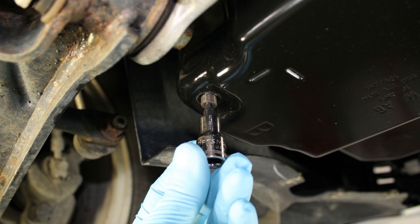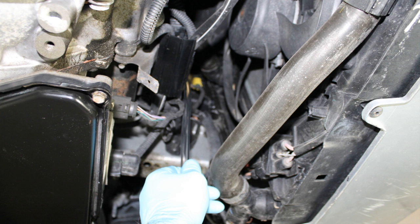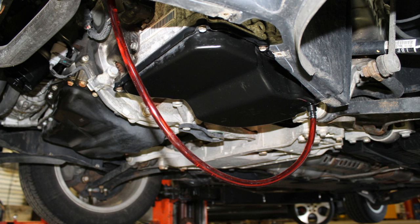Reinstall the transmission fluid level insert using a 5 millimeter Allen into the drain plug port. Leave the insert snug and do not over-tighten, as this is made of plastic. Hand-tighten the fill adapter onto the transmission pan. Once the fill adapter is installed, slide the fill hose on as pictured. Slide the loose end of the fill hose up in front of the transmission and connect it to the fluid bottles as described in the supplied instructions. Allow around 2.5 liters of ATF to flow by gravity into the transmission. As fluid is being fed into the transmission, start the vehicle. With the brakes applied, shift through all the gears of the transmission while the engine is idling, allowing 5 seconds for each gear selection. While the engine is in park and idling, continue to gravity feed the ATF into the transmission. Allow all 5 to 6 liters to flow into the transmission, then remove the fill adapter and install the drain plug.